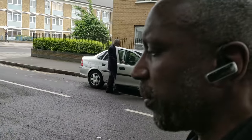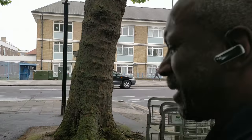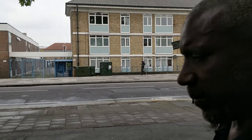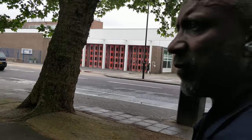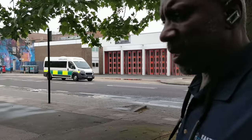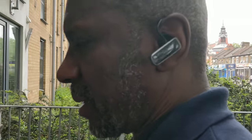We had to move the van because our parking ran out, so I've still got to go back there. I checked the circuit right to the cooker outlet, reconnected it, isolated the oven and the hob, left the isolation switch off, but when I turned the circuit back on, it still tripped.